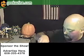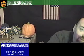Let's do it again. And then, sometimes you have to be just a touch bit forceful, not too forceful. You might not have all the screws out. Pull up. Of course, it's not being nice right now. Then you get another screwdriver up, do a little bit of prying. And then you hear a small pop. Of course, you want to be careful, because some of these cases, they're just held on by plastic tabs. So you want to make sure that you don't break anything. But voila, look at that. Case is right off. And right here, we have the hard drive.